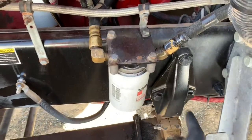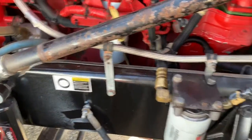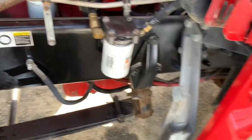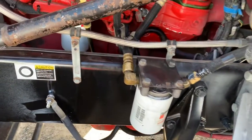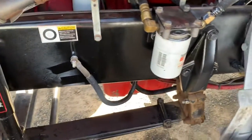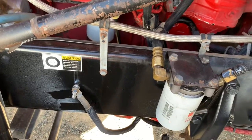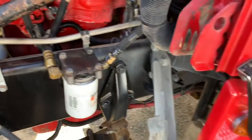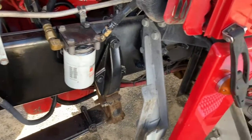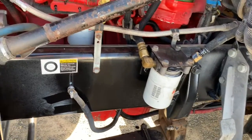I undid the fuel line — there was fuel in there. You turn the key, the transfer pump makes noise, which means it's pumping. I took the fuel from there, primed it, took it off again — it pumped fuel, that was good. Then I got a bucket, took this line off, put it into a bucket and ran it from the bucket to make sure there were no problems — like ruling out a cracked pickup tube. It didn't start, so that ruled that out.